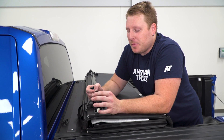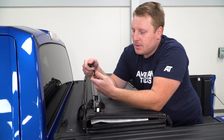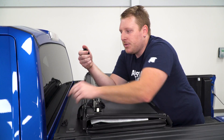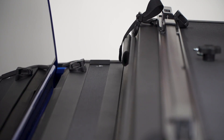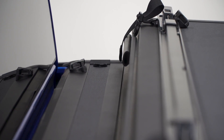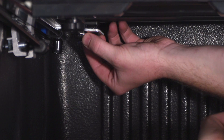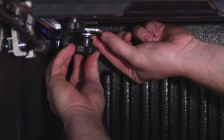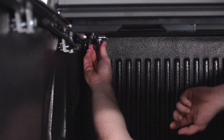Next, slide the bed cover back and get the big pre-drilled holes to line up with the aluminum bracket underneath. Separate these knobs — this section goes down through that hole. Do the same thing for the other side, then crawl underneath and place the hardware. Placing these down, keep one rubber washer on them, then underneath install a rubber washer, flat washer, lock washer, and the knob. Tighten these up a little bit but leave them pretty loose because you still need to adjust the bed cover.